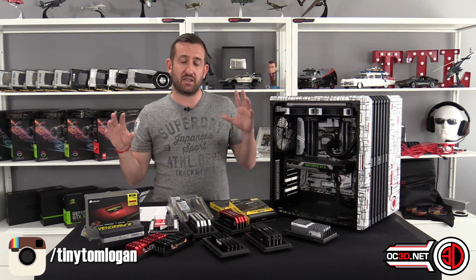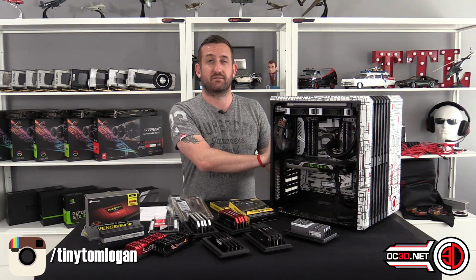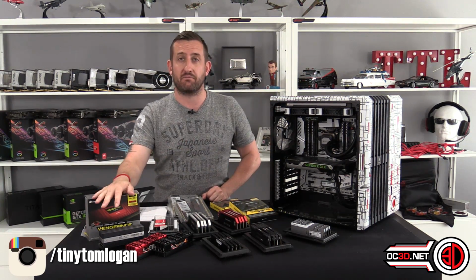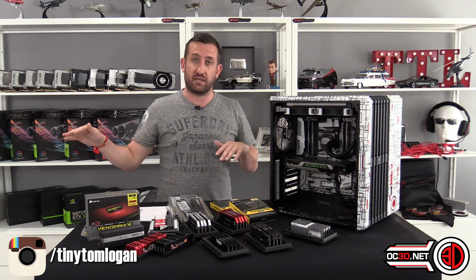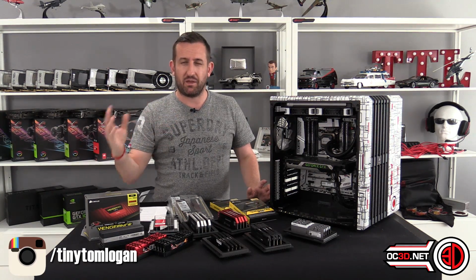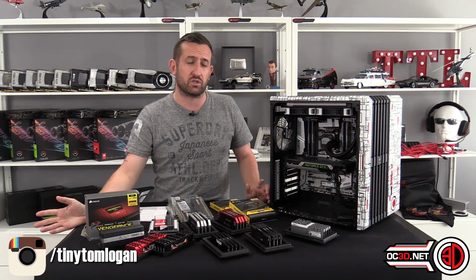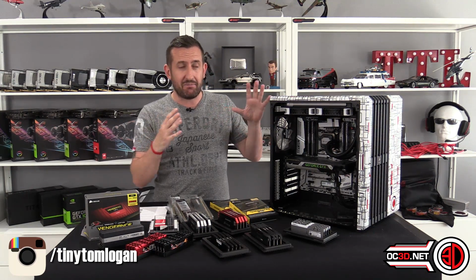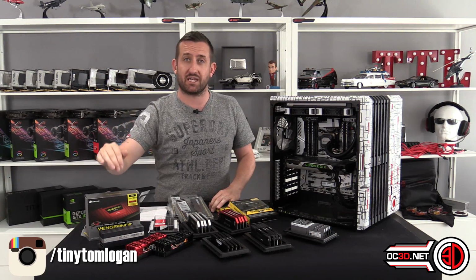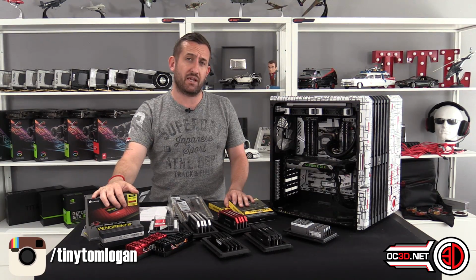The problem is that there does seem to be a fluctuation between CPUs' temperatures. Now, I've always used the same one, so I know what mine is capable of. So when I say to you that this has gone up just by making minor changes, it's not the difference between CPUs, it's because something's wrong, and there was. The temperatures jumped. So I went looking in the voltages and couldn't find anything untoward. To me it's saying there's a voltage that I'm not seeing or don't have control over, that's been ramped right up to get the memory to play ball. But like I said, it's made a massive difference to temperatures.